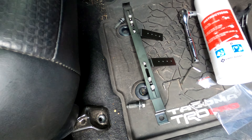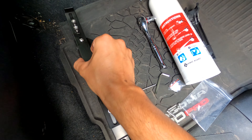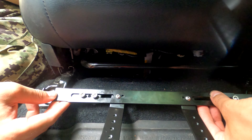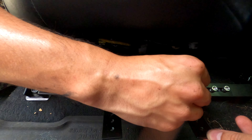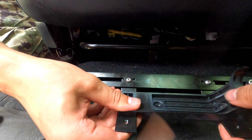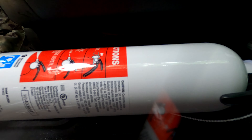I got the big bolts off, got these threaded on both sides, and loosely threaded the support plate on for the extinguisher. I'm going to face it the other direction. I rest it up in the spot it's going to be, set the larger bolts back in and start threading them down — sorry for the car noise, there's so much traffic. I tighten these down first using the smaller Allen key supplied with the kit, then slide it all the way to the left and use the bigger Allen key to tighten it down completely. It clips back in place just like that — there's the fire extinguisher mount.